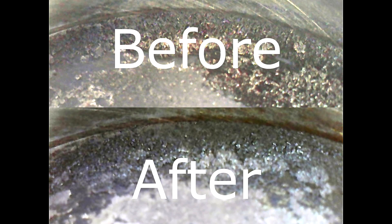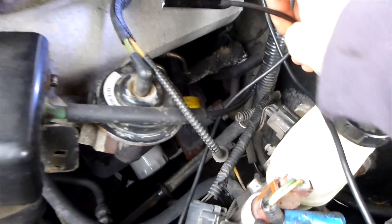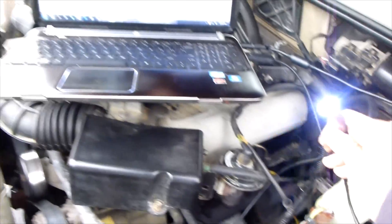Let's get out of cylinder five and check out the last cylinder, cylinder number six. This actually looks pretty good. Let's get a before and after. It's hard to tell if there's any real difference here. The biggest thing is there's still a lot of carbon in there. Carbon buildup is not gone — the piston is not completely cleaned, or even halfway cleaned, or even a quarter of the way cleaned. So I think that just gives us a pretty good idea of what kind of results you should expect after round two of Gumout.